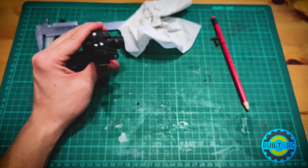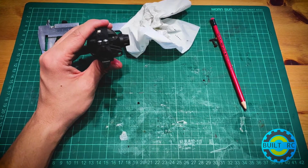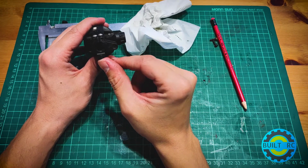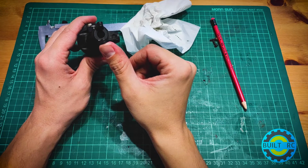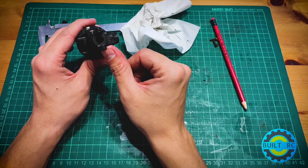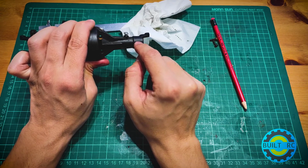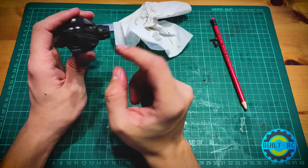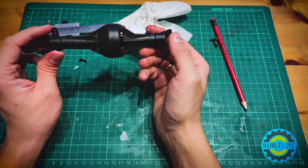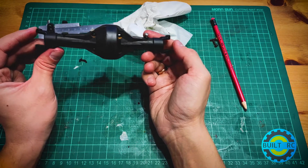So we have like a good position, yeah, no excess angle, because too much of, I believe it's called caster angle, too much of caster angle also will not work, so we need some moderate value. I will take a look how it sits on SCX10 2 axle. Put it here like this, drill hole here and here, and screw it. I will screw the C-hub to the axle and through this reinforcement tube.